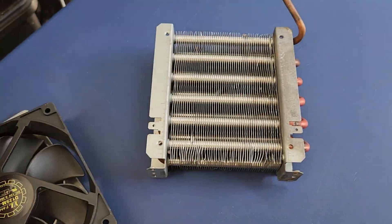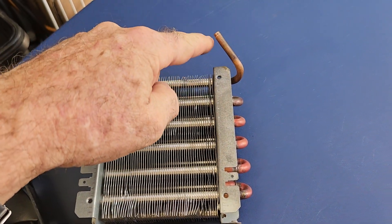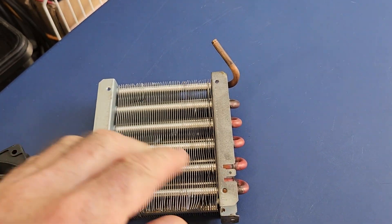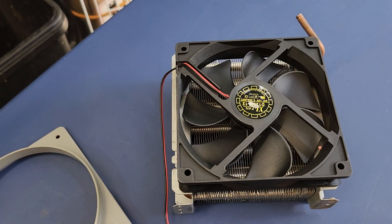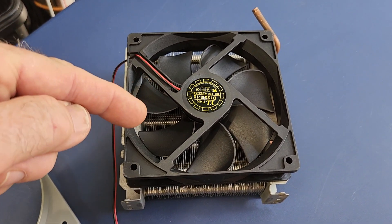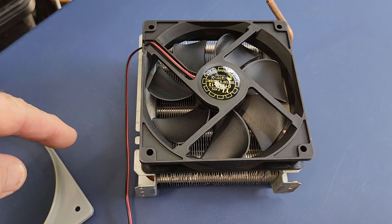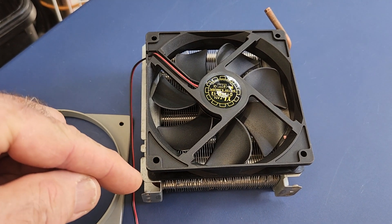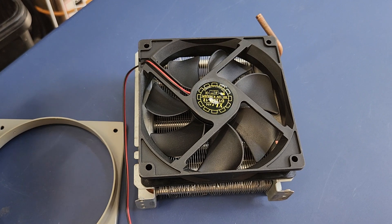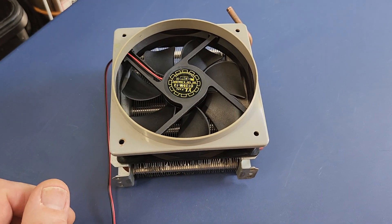Here is what's inside the fridge - this is a different version. The other one had a wraparound black tube arrangement; this is like a mini car radiator. The hot refrigerant comes in here, circulates through the fins, and dissipates heat across the entire structure - just like a car radiator. A fan sits on top and either sucks or blows air through to get rid of the heat. By the time the refrigerant exits at the bottom it's at ambient temperature, in liquid form, ready to go back into the fridge to turn back into a gas and get very cold.